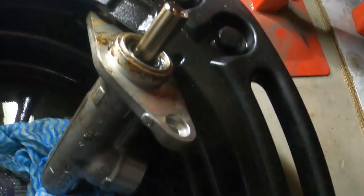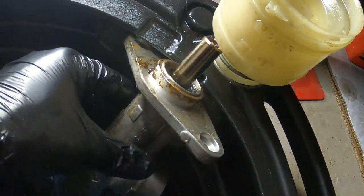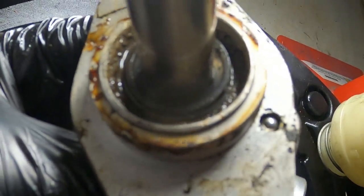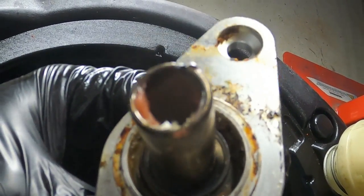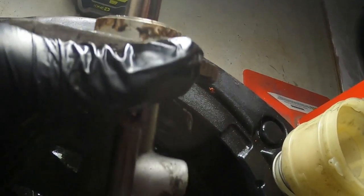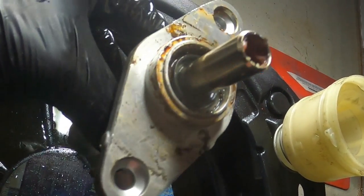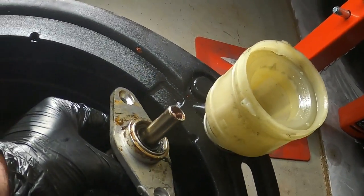I just want to show you something. With a size 10 you can remove the reservoir — it's in good nick, it's just dirty. This is where we need to work. See how it's clean from here — this is where the reservoir sits on, this is where the brake lines hook up, and this is where it goes into the brake pedal. There's a retaining clip over there, you just need to remove that clip — that allows you to remove all the seals. Once you remove the seals you'll be able to get basically the cylinder and pretty much everything inside. There is a repair kit for this one, or I think they call it a service kit. For the price, I think I'm just better off getting a new one — just to be safe. Because at the end of the day, this is a brake. Don't stuff up with brakes, and don't cheap out.